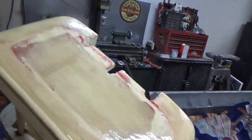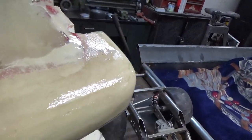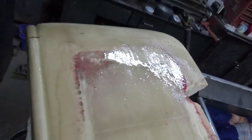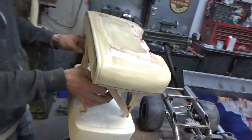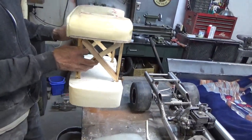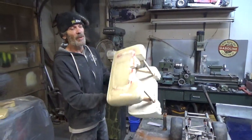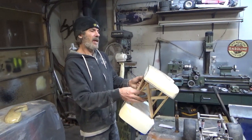And that's like the back. It's like we got the plaster on there, and the plaster kind of did the same thing. It did gouge away a bit and left quite the ridge, but now that we've got a layer of polyester on here, I'm hopeful that the polyester resin keeps everything sealed together, so I can basically do some body work, put some fillers on it, sand it.